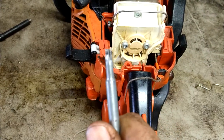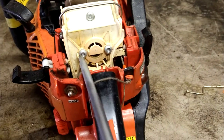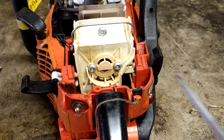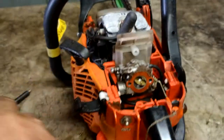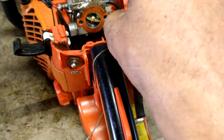There's three bolts — this one, this one, and this one. I'll also put the fuel lines, primer ball, carburetor, air filter, spark plug, and everything else in the description below. This comes right out. The choke arm lifts right up — twist it right out.